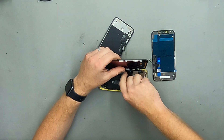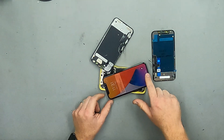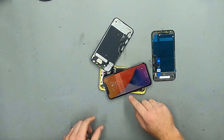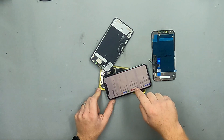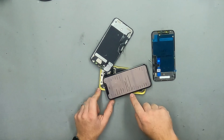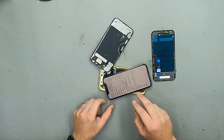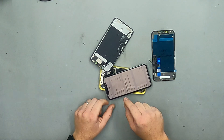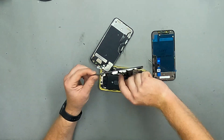So this display notification was brought in with the iPhone 11 series. Here you can see when I've got the refurbished display with a non-calibrated IC connected, it shows the important display message which says 'unable to verify this iPhone has a genuine Apple display.' When you click 'Learn More' it takes you to Settings > General > About which shows the same message. It's important to understand that this iPhone is not actually trying to find out whether the display connected is a genuine display — it is just trying to work out whether it is the uniquely calibrated display which was calibrated using the Apple calibration tools.